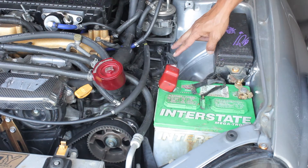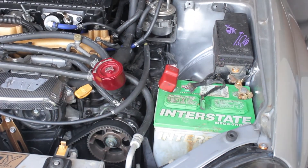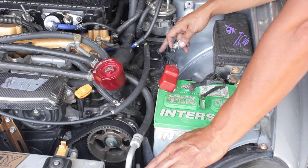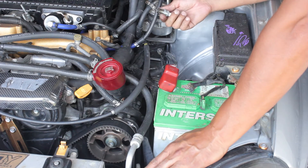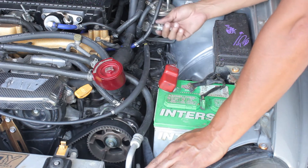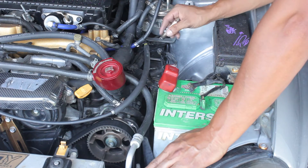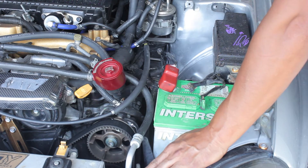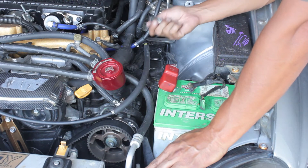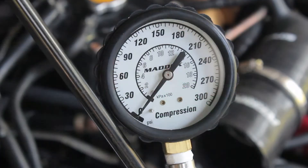Let me take off the coils, remove the coils and the spark plugs. Here's the spark plug on cylinder number four — somebody suggested to crank it and see if the spark plugs were wet with gasoline. They are wet, super wet — the engine is getting fuel. I'm going to check compression first and then check for spark. Let me take the other ones out — here's cylinder number three.